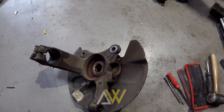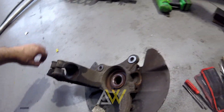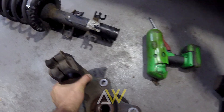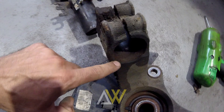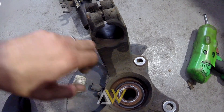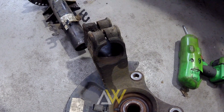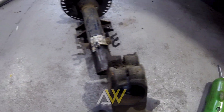From watching Transporter HQ's YouTube videos before starting this, I learned that this sits upside down - this is actually the bottom of the hub and the strut comes out this side going to the top of the wheel arch. This little bit here acts as a stopper for the bottom of the strut. What I saw the guys at Transporter HQ do is basically grind this off so that if needed we can lower the new strut further into the hub assembly to get lower - if we want to.